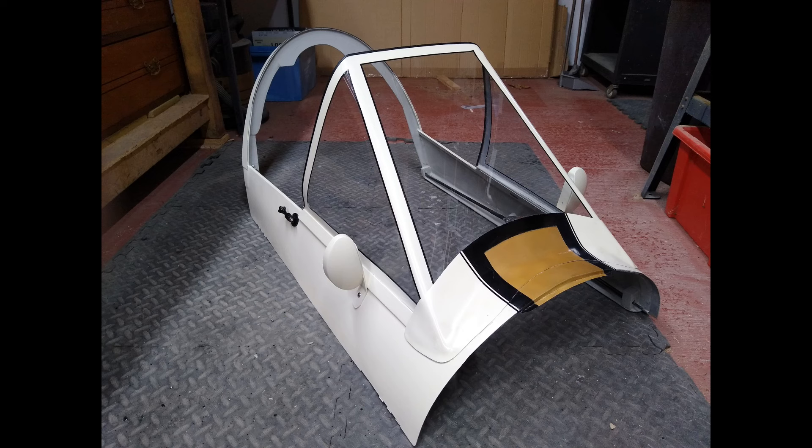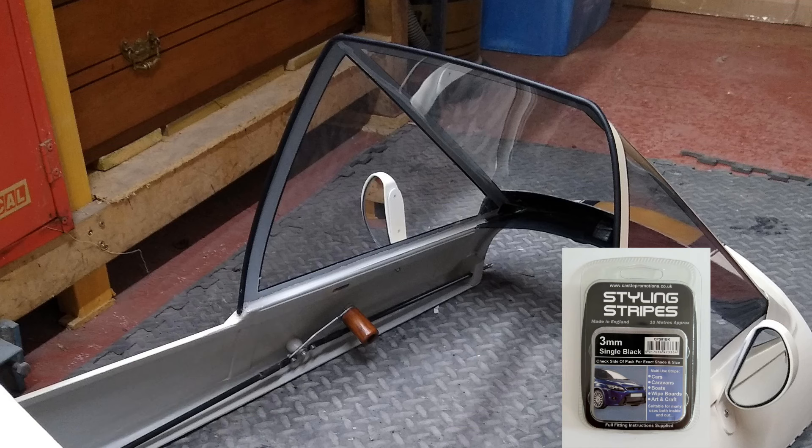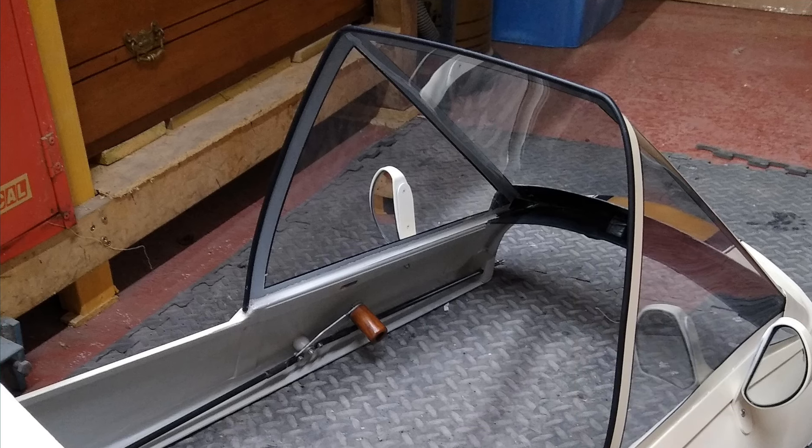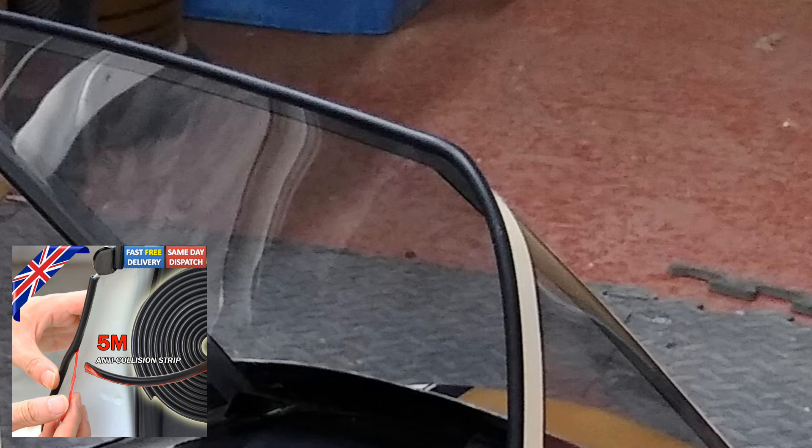I escaped any punctures and this is how it all looks after a clean up and a paint job. The front contour panel is held in place with Sikaflex adhesive sealant which is really strong but also slightly flexible, so I hope it will absorb some airframe vibrations — I suspect the one-piece screen won't be as solid as the three-piece version as there's no stiffening from framing. The framing you see is just paint: grey first because that's what you'll see from inside, then Old English White on top followed by black edging tape. I used whiteboard tape — 30 metres for £2, as opposed to the same tape marketed as car pin-striping tape at five times the price. The final flourish was the self-adhesive edge protection profile which completes the job quite neatly.